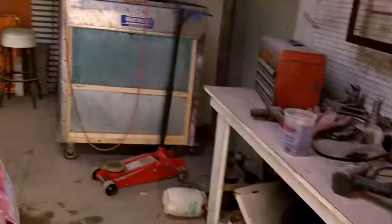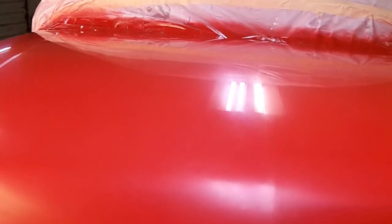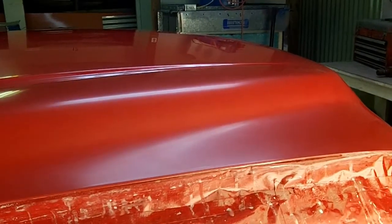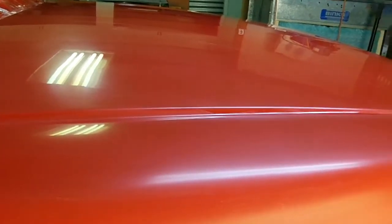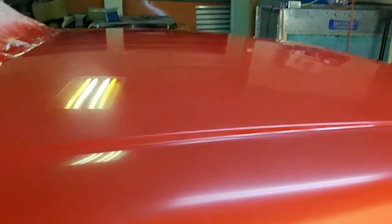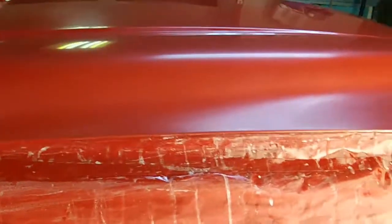But now we can see this hood now that I've dried it off, and it's uniformly dull, and that should buff up real nice. So thanks to Ron for the vote of confidence that I'd be able to sand those watermarks out. I've never had to sand quite that hard on anything, but I was using the 2000, so it doesn't cut real fast. And this was the area right along that whole area from that body line up there where it's still a little shiny, because I don't sand in those unless there's a piece of trash in there, and there wasn't. From there down on this side, and then no water on the other side, just a couple trash pieces. So it all came out good, and that's going to get to sit.